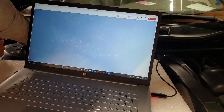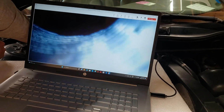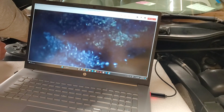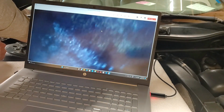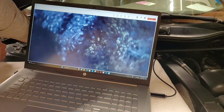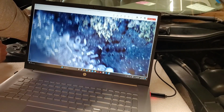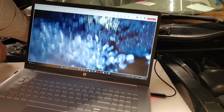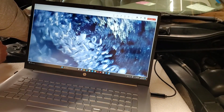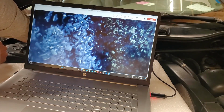We're now down looking at the cylinder, or the piston, I guess. We're just coming through the spark plug hole here, and that is the top of the piston. So we do have some carbon buildup. That's very normal, especially in a high mileage engine. It looks like we do definitely have some metal shavings. So now you can see clearly we have quite a bit of metal shavings down in there. We're going to want to get all of those blown out. So you can see the grease didn't obviously collect all of them, but definitely collected a fair bit. But we do have lots down there.